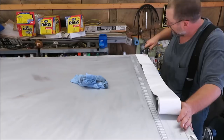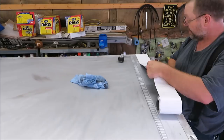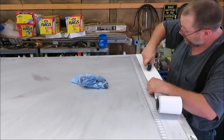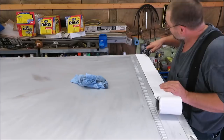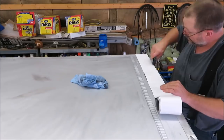Now I'm going to work on pulling this the rest of the way across. What I'm going to do is just hold my little plastic, pull it back a little bit, line it up where I want it, put it down, and then take my little roller and get right in that little seam there and roll that all the way across. You can put the edge of that right in the seam — works pretty good. Round your bolts, everything. And then just do this side the same way and just keep working our way across. That's all there is to it.